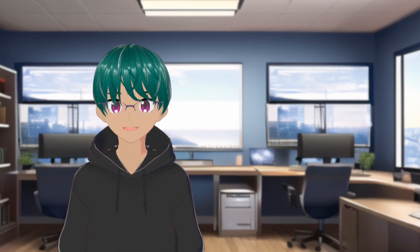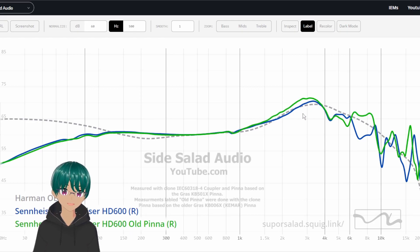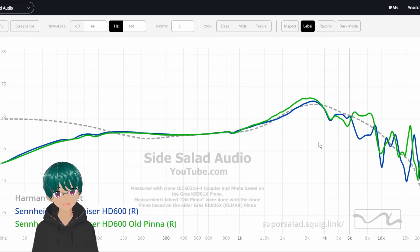For my measurement database, I updated most of my headphone measurements to have both the new pinna and old pinna so you can compare yourself. When looking at this, we can see that this looks like an HD600 measurement. This pinna is supposed to be more compliant towards the Harman target, so I switched the default target back to Harman. When we bring back the old measurement, we can see that there is some noticeable variation between them — the old pinna seems to emphasize the upper mids more, and then there usually seems to be some more treble peaks in it. Even this difference would be within the realm of unit variation or even just measurement variation from how you place it on the rig.